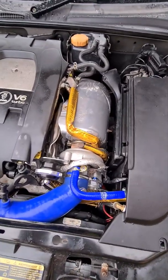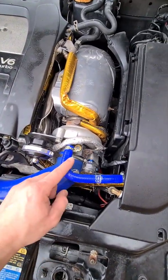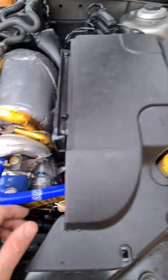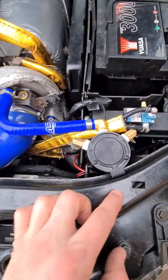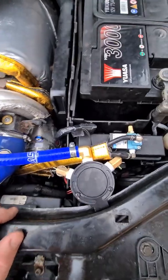Here's the finished result of the breather modification. There's a little one-way valve here and the pipe runs back from the head to the catch can. There are two pipes which loop around underneath, and the catch can just bolts into the slam panel — one pipe in, one pipe in, and then that's the outlet once the blow-by has been filtered.